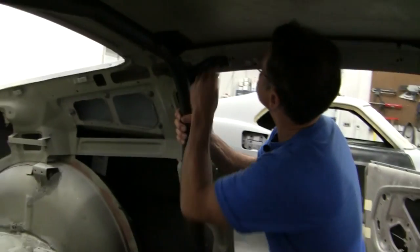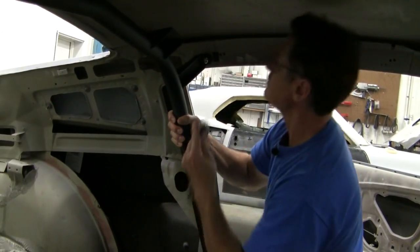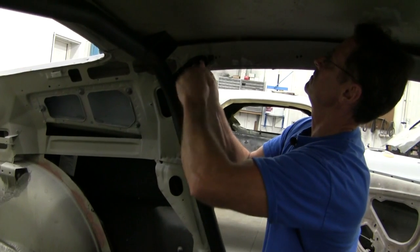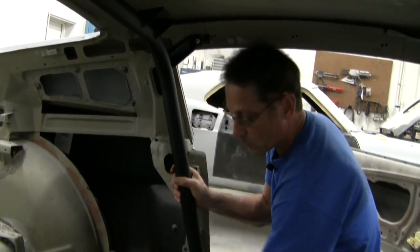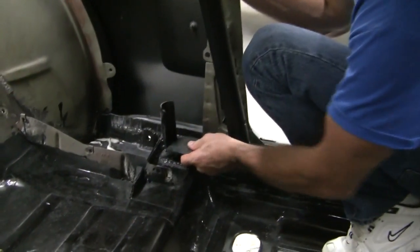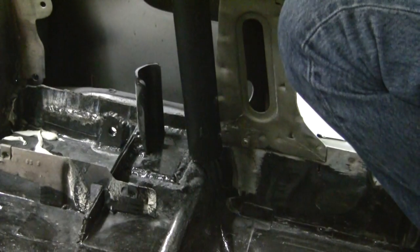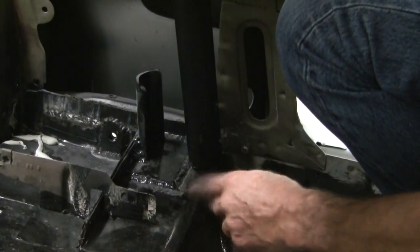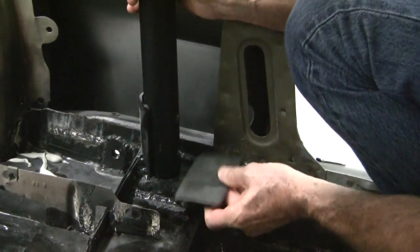So all we're going to do is fasten this side over here, because this is the first thing you want to do — get your roll bar in where it needs to be. Now what we're furnishing you with is a flat plate. This plate is going to get welded up on top of the torque box. So all you're going to do is get this plate basically where it needs to be, run this roll bar back. Most of the time these roll bars are short enough that you probably don't have to cut them down, but sometimes you might have to — it can depend on the torque box, if the car's been wrecked or repaired or whatever. Otherwise just let the roll bar float back right where it needs to be and then position your plate underneath it.